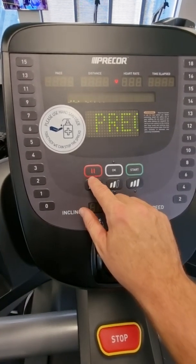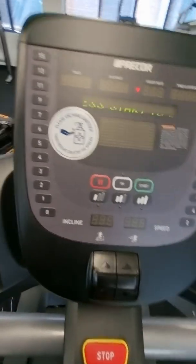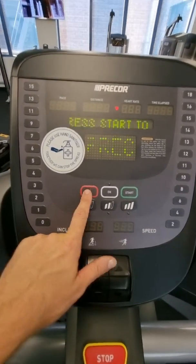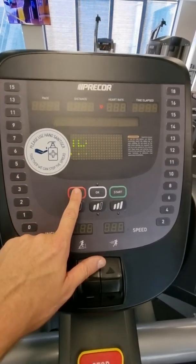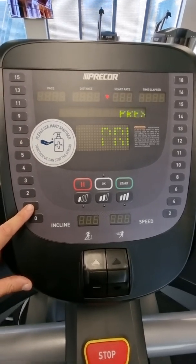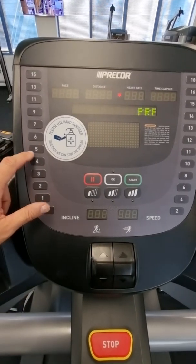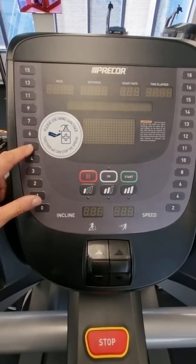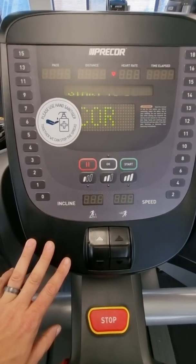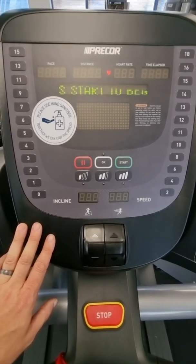So all these settings will work: pause then 6-5 gets into diagnostic mode; pause 5-1-7-6-5-7-6-1 gives you the technician's maintenance mode; or pause 5-6-5-1-5-6-5 gives you the club mode or user settings, which are just a few more basic settings on the console.